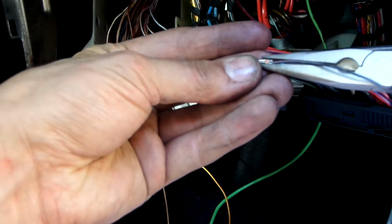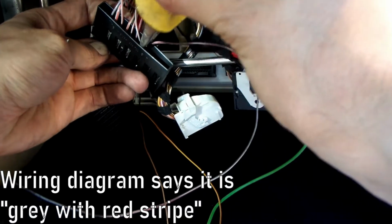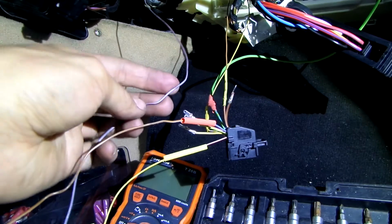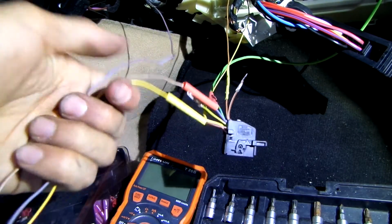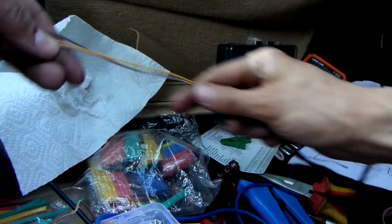The wire for the light connects into one of the comps. Search for the one with the light blue red striped wires. They should be hot with the marker lights switched on. So that is our wire for the light, and I've connected the other two to the appropriate pins of the connector. Now we just need to pass all three to the other side.